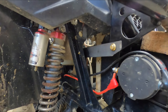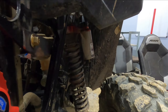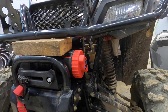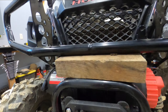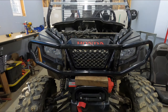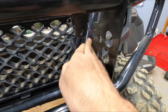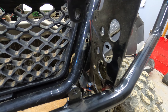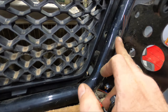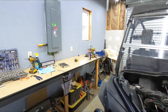So there's the bottom brackets attached quick and easily. I think that's going to work nice because there's actually quite a bit of strength there — I'm pushing the whole buggy. So I think that's going to work quite well. She's pretty level right there. So now I'm just going to come up with a little angle bracket for right in here, and that'll be good. Hopefully just a simple hole here to here, and I might be able to reuse the same nuts and bolts I had my light bar attached with.